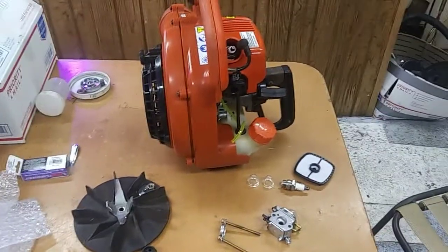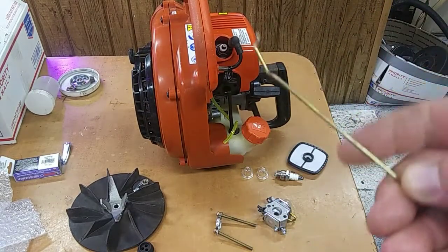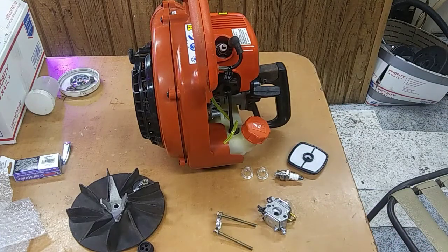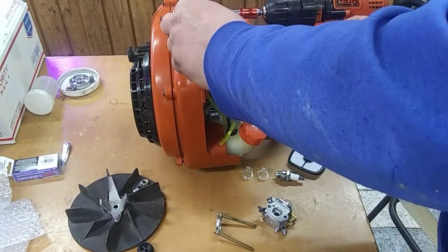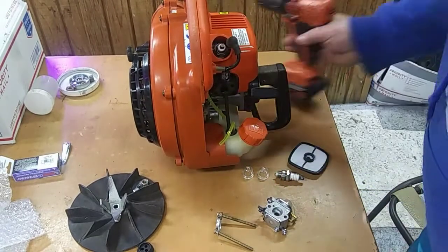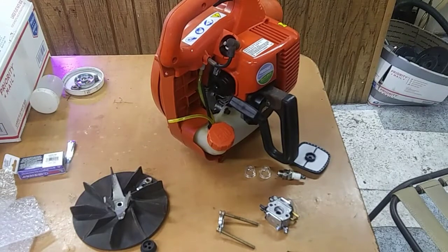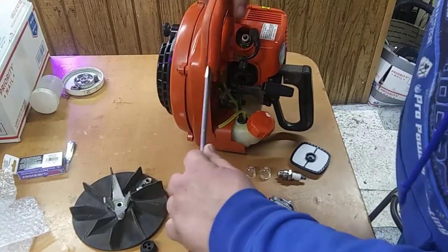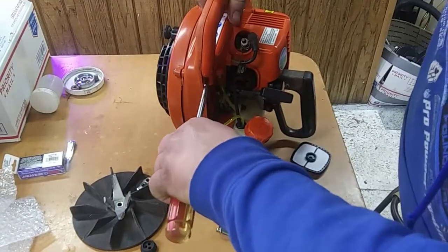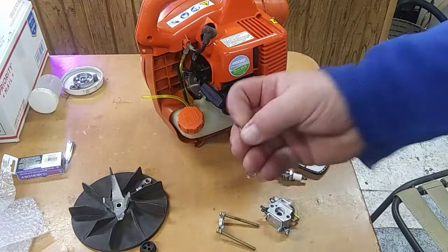Let's get on with the carburetor install. If you've seen in the first part, our throttle thing fell out. To get that back in there — I've already did it once earlier just to see if I could — by removing the two screws in the handle right here, I was able to pry it open. Just take a screwdriver, work it right in there, you were able to catch the back end. It's just a black piece on your trigger that goes back in here; it's got a hole in it, you just gotta fish this in there.